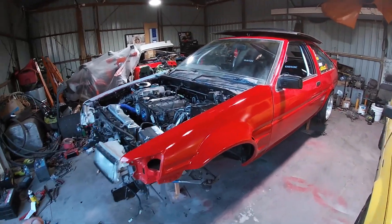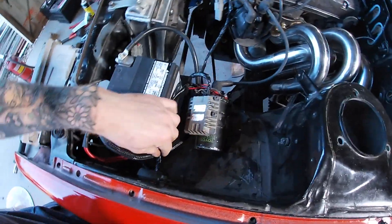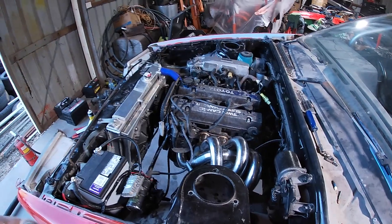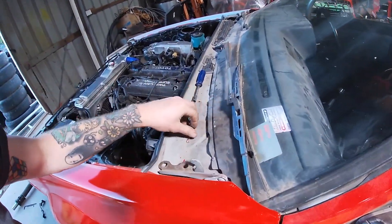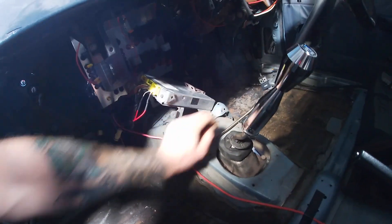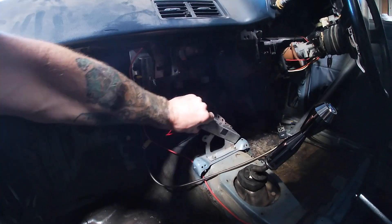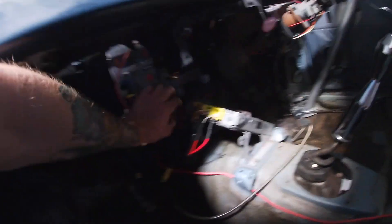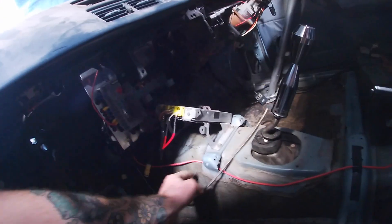She's half put together, starts. Fixed up some of that wiring that needed to be fixed up and ran it through there. I've locked in the dizzy at the timing it is at — it will need to be changed obviously with an actual timing gun. I suppose I'll show you the inside. We've just pretty much mounted that like so, put some nutserts down there and chucked her in. It's pretty sturdy, I'm pretty happy with that. I've kind of messed up a little bit of the wiring, made it look pretty shitty, but it works and that's all I want it to do at the moment. Pretty backyard kind of job.